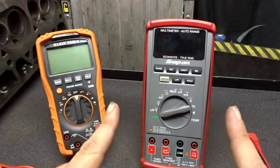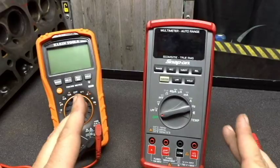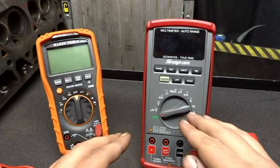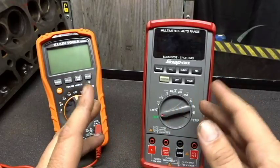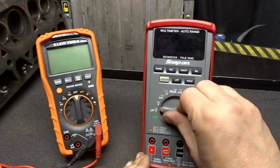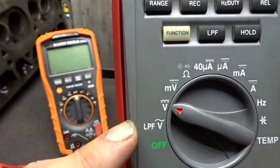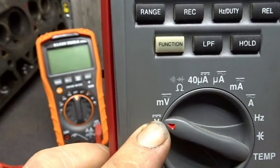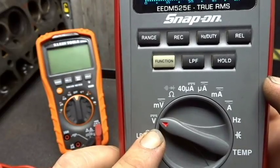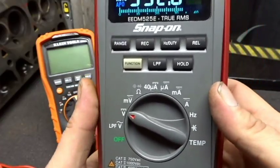I'll show you the features most commonly associated with electrical troubleshooting in automotive, but first let's cover some of the key basics. On this DVOM, I would say there are three settings you're most likely to use within automotive. The first is volts DC. You can tell because it looks kind of like the markings you would find out on the road. That's direct current and will be one of your most used settings on the DVOM when you're testing or doing electrical troubleshooting on a car.